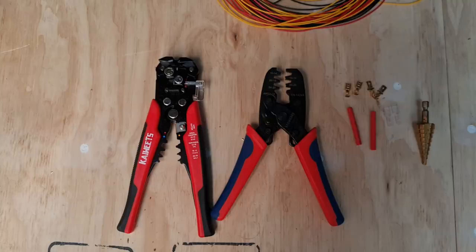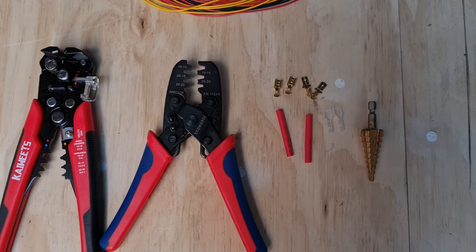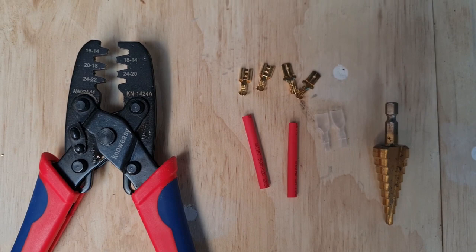So what I want to do is wire up switches in the lights that I can turn on and off as required. Tools you need for the job are some wire strippers, a crimping tool, both two sets of male and female spade connectors, shrink wrap, and some insulating covers.